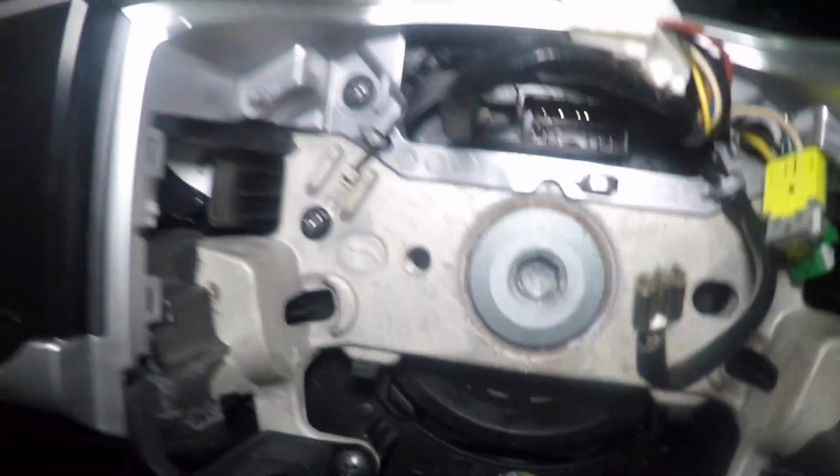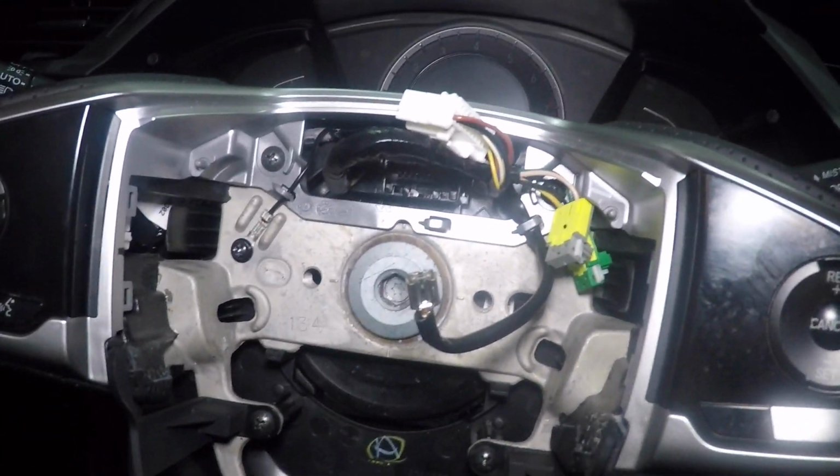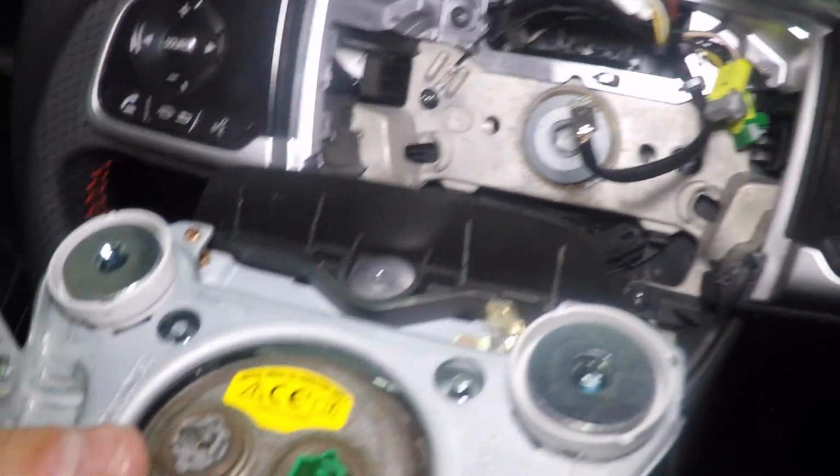Oh yeah, so this bad boy right here torqued down to 36 foot-pounds. That's where you're going to want to be, so I'll put that torque spec in the bottom. And the torque spec for the T30 screw is going to be about 9-10 foot-pounds. But what's important is that this be torqued down good, because you don't want your car to get exposed in traffic. And when you put back the airbag, you're going to want to color match everything.